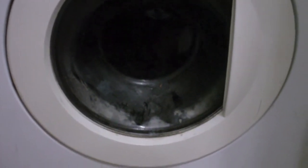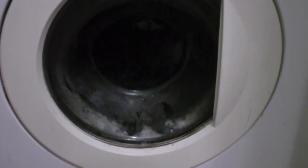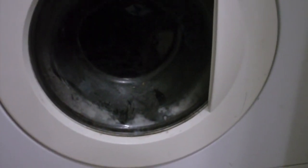That's also why everything's soaking wet in there. There's not a lot of water in there because these front-load washers, by design to be environmentally responsible, use very little water. We're going to check out what's going on with the pump. The pump on this model is located right up in the front here. So what's nice is, if we're lucky, I can actually effect this repair without taking the machine out of the closet — we have it stacked in here.